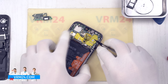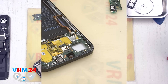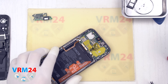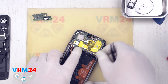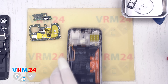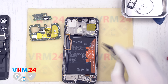We tried to take out the motherboard but we forgot to remove one screw. It is important to note that we should never pull anything in phones — if something doesn't go or interferes, it is better to check everything first. The speaker, fingerprint cable, side buttons, two coaxial cables, and vibration motor are left in the body.